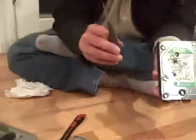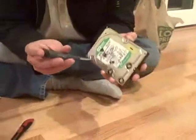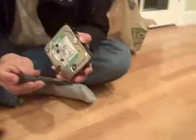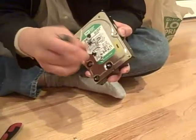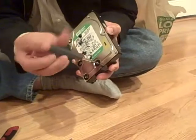First, you've got to have a torx screwdriver because this is a special type so it can unscrew these. And sometimes you need a scraper for hidden ones, like under the sticker — like the one in the middle there. And the black ones around it, those are all hidden. Some hard drives are different from others, so some might not have a bunch of covers.